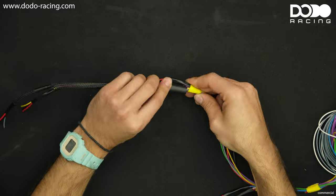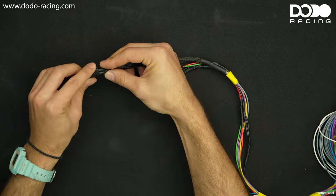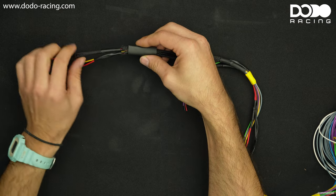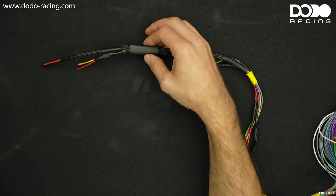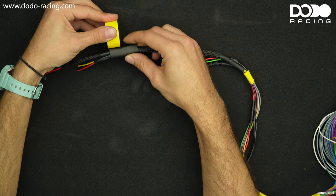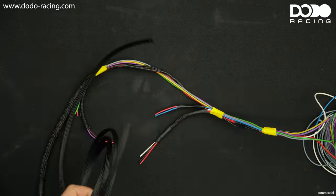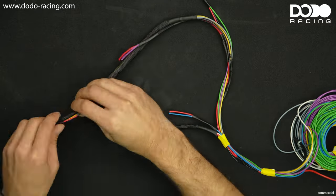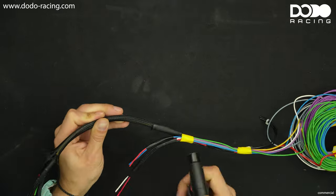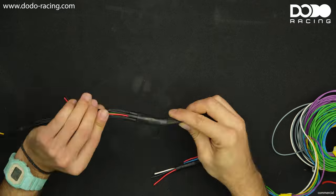All coil wires are protected now and we will start protecting the main harness. I take a larger hose and measure — we need space for the heat ring on both sides. Now you can see why we moved all our tapes a little bit further down the line. This way our new bigger heat ring can extend over the smaller ones and grab them tightly. That's when our 4-to-1 shrink ratio comes in really handy. If you find it a little difficult to put the hose on, it's easier to push it than to pull it — because when you push it, it expands.